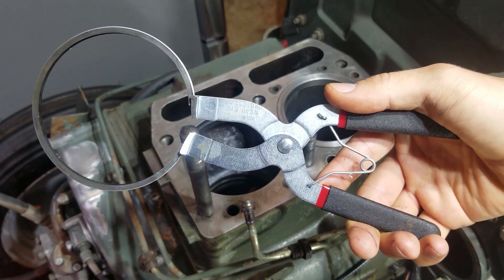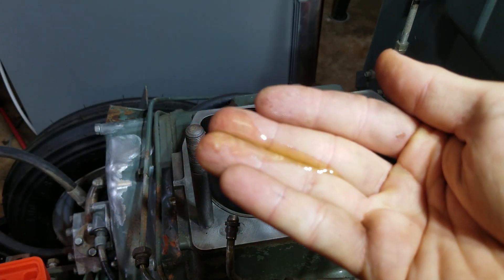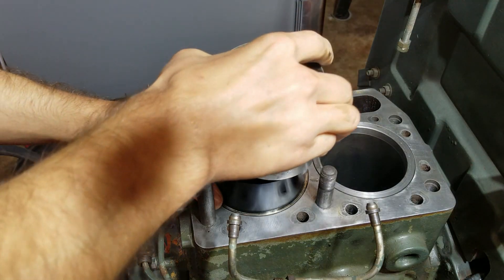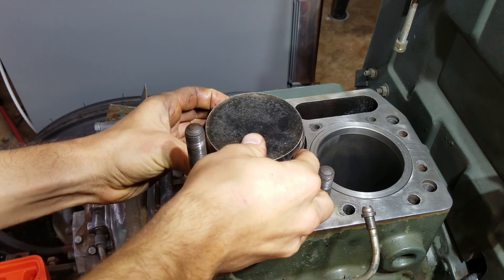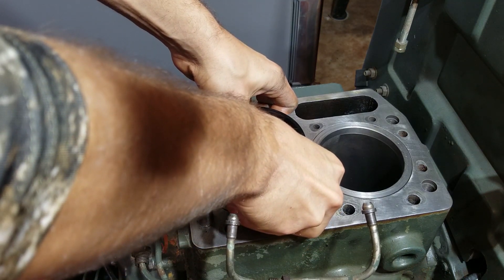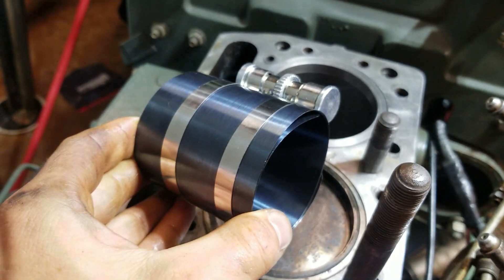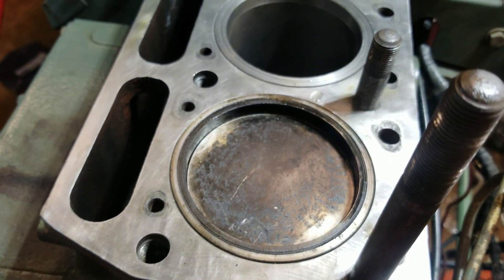Let's see that compressor tool in action. Here's an old broken piston with the rings on here — I know it's missing the bottom one, but you'll get the idea. Man, that thing went right in there easy peasy. You know how hard it was to try to compress it with the standard tool? That thing just slid right in there with those eighth-inch thick old diesel rings, and we didn't break a single thing.